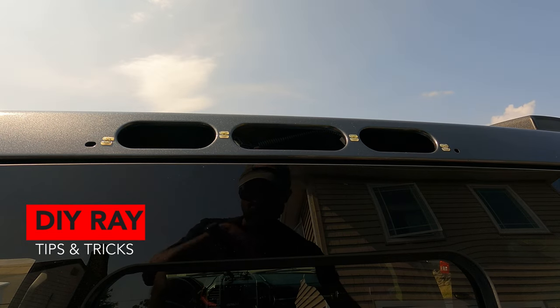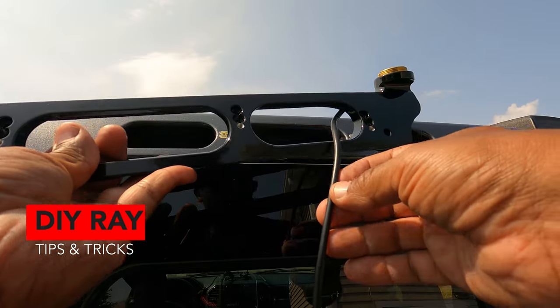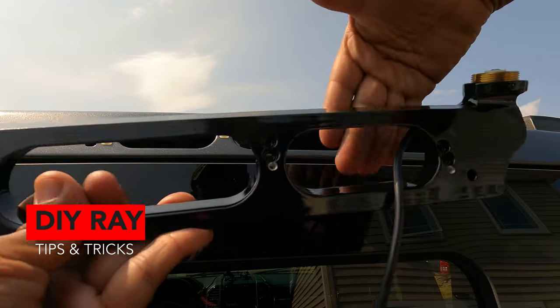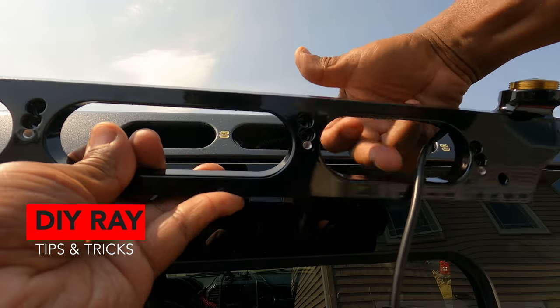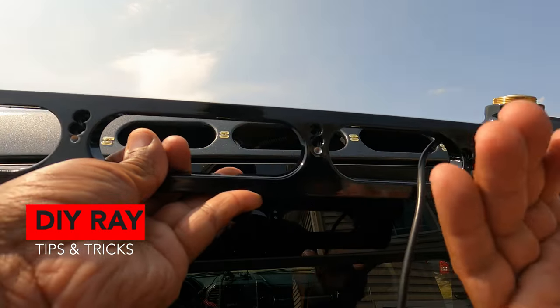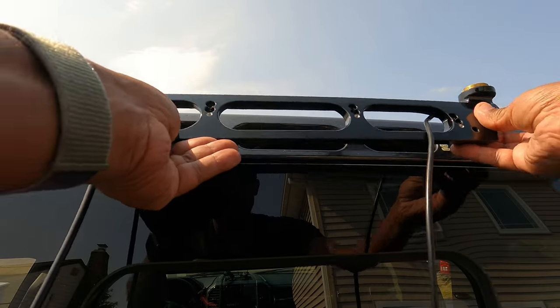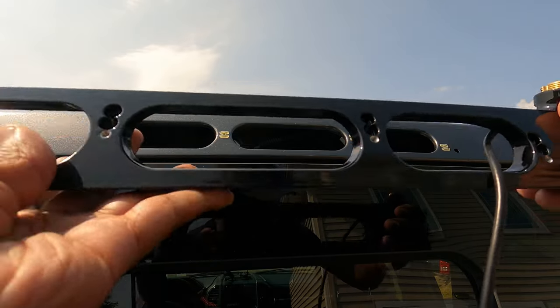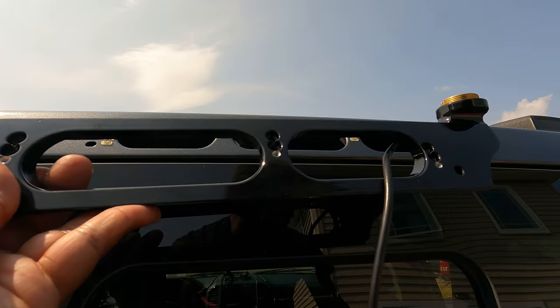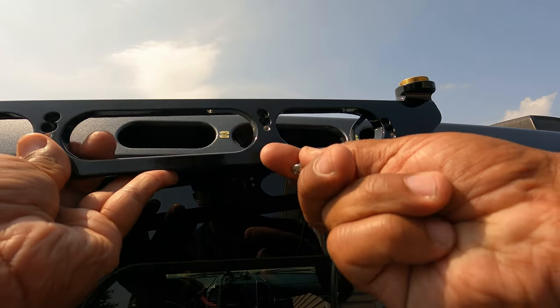And once that's done, you're going to have your mount. The cables here are going to be on this side. So you're going to have to fish these cables, the radio cables or coax cables, back towards you. Get this mounted up temporarily. So fish that through. And you're going to have to break out your screws. They give you four Phillips pan screws, the pointy ones like this.